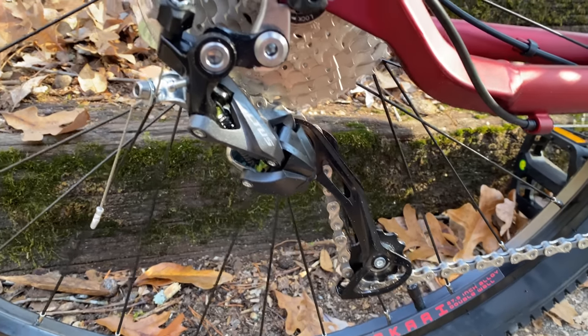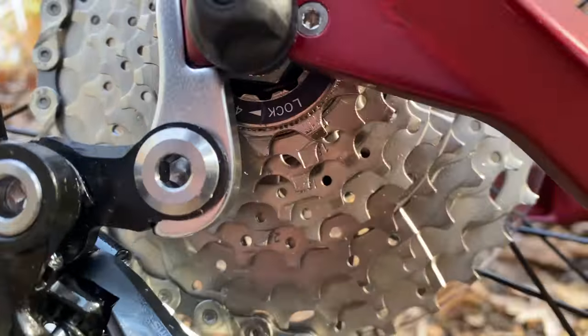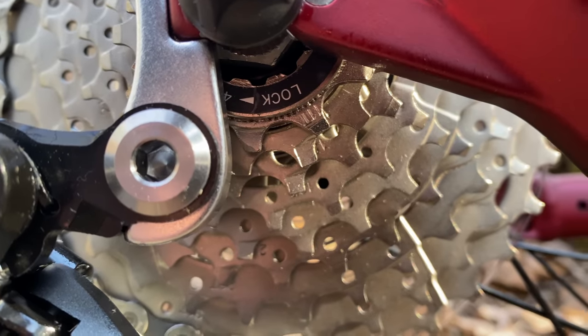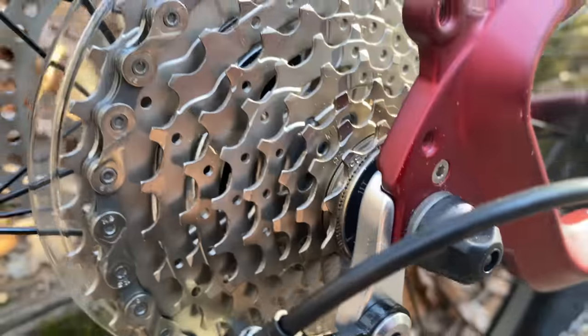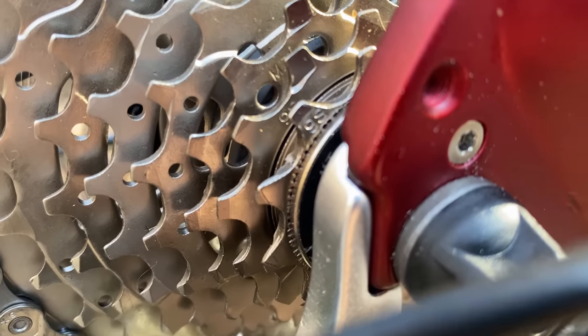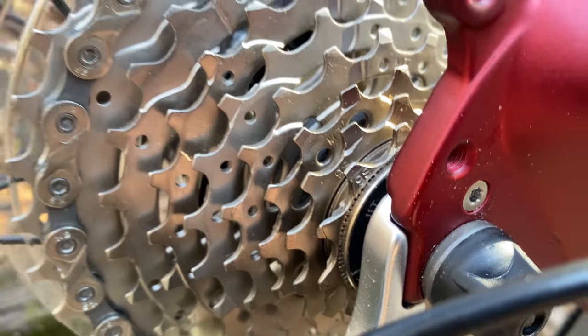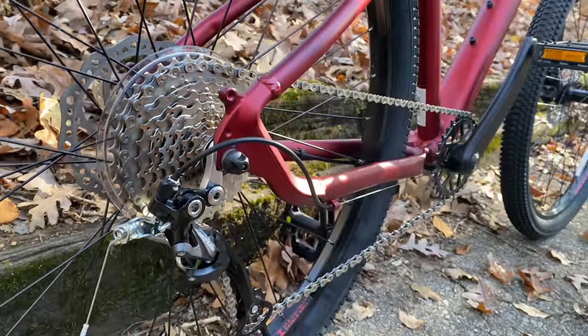We've been seeing budget clutches with iffy reliability of late, and with some other brands Shimano Altus is a safe choice. The best part of the drivetrain though is the cassette — no freewheel, this is a cassette; note the lock ring. The brand is L2W and the range is 11-tooth to 36-tooth, which is a good compromise for decent top speed and fairly easy uphill pedaling.